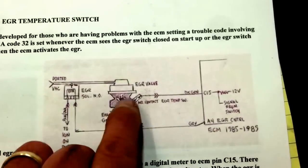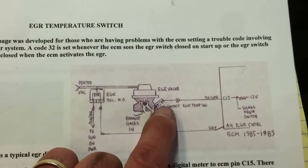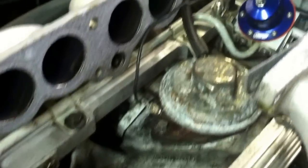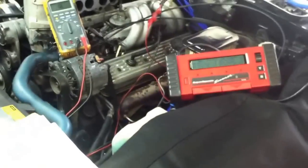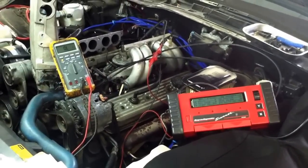The computer wants to see this switch close in a matter of seconds after it's commanded that on. What we noticed was this switch was stuck closed, so we've got a new one on order, and I just wanted to show you what that looks like. Once we get that new switch in there, we will test the duty cycle on the solenoid. This is part one of the 89 Chevy Camaro IROC with the code 32 — part two coming your way.